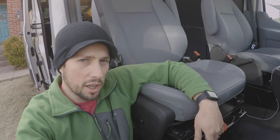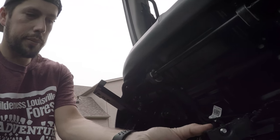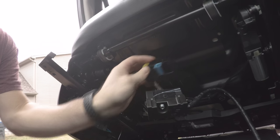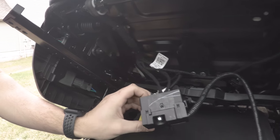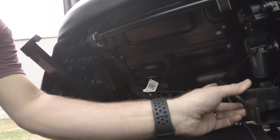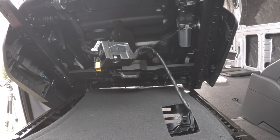On this power seat there's a big connector underneath the seat that's clipped in, so you have to use a screwdriver to pry the clip loose and then pop it off. Rather than trying to take out all of the individual ones, you can just loosen this bolt and the whole plug disconnects. Now I just have to remove this piece so that the seat and the cables are disconnected, and then the whole thing can lift off so we can put the new swivel in.